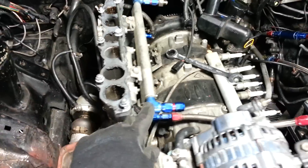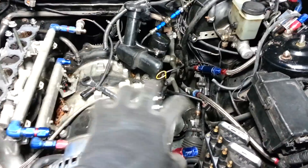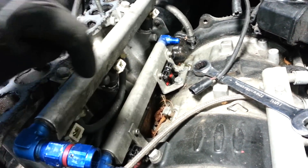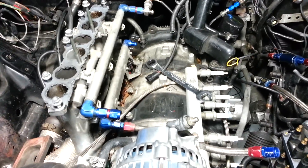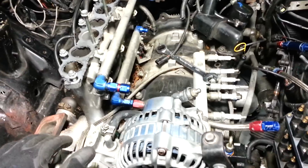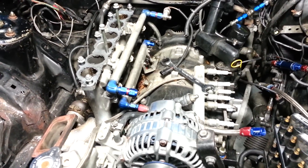So the air goes rushing through here. This is the fuel system. Fuel comes from the back of the car, filtered with that little blue thing there — two lines come up and go over to these rails. These rails, as you can imagine, are pressurized. Those little injectors hidden under there are electrically opened and closed — just kind of like a floodgate, always pressure behind it. They open and close at milliseconds at a time. You'll hear that called pulse width or injector duty cycle. If it's 100%, that means the injector is flowing 100% of the fuel 100% of the time — you can't flow more fuel because your fuel pressure is only a certain amount, so basically your injectors are maxed out. You can run your car temporarily like that, but that's not a good idea.